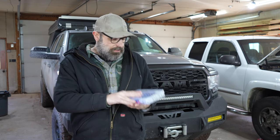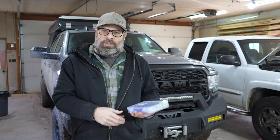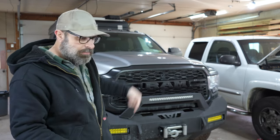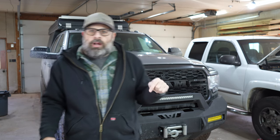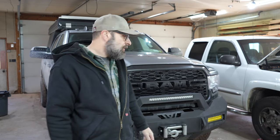It's a couple days later. I ordered a set of Zerks — all different sizes, straight ones, 45s and 90s. We're going to be using this. I've got the truck pulled in front first here. We're going to swap out this end link. I'm going to put up a picture of the directions because I had to look them up. I wanted to double-check the foot-pounds on these end links. It's a hundred foot-pounds. I'm going to put up the full set of directions right here.